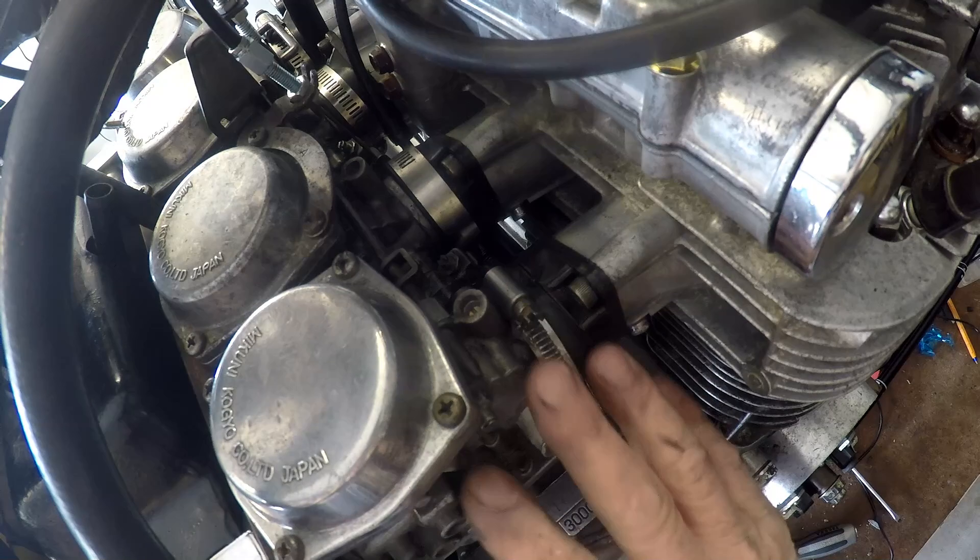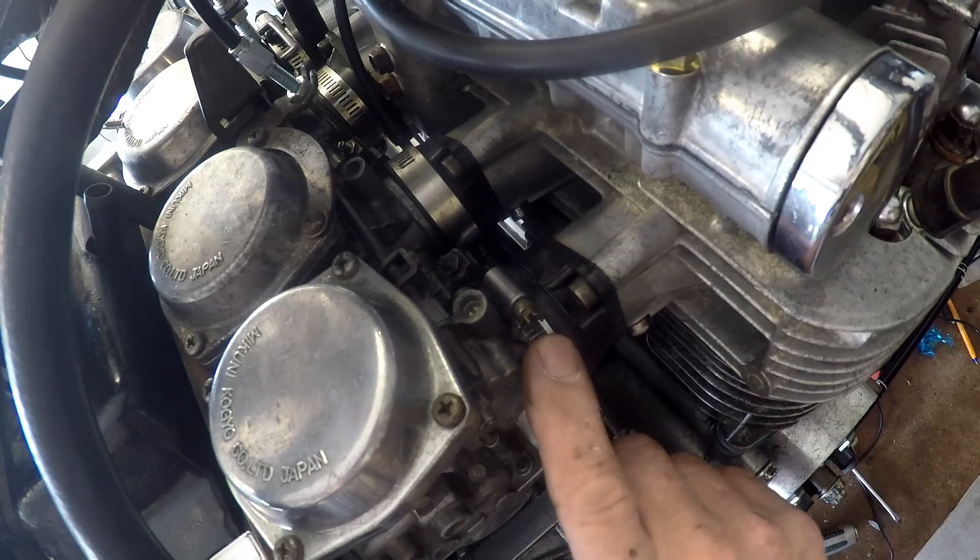Let's have a bit of a chat about what's going on with these carburetors. The carburetors that came with the earlier GS1000 — the VM Mikunis — had a much smaller diameter spigot on the engine side. That's why it was such a nightmare trying to force these 42-millimeter diameter spigots into a manifold designed for a 34-millimeter carburetor spigot. The length of the carburetor and manifold assemblies also concerns me, and with those carburetors the atomized fuel is just smashing into hard edges.